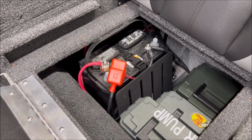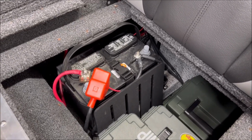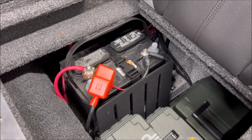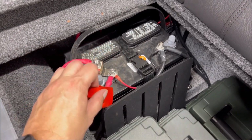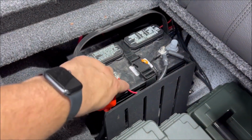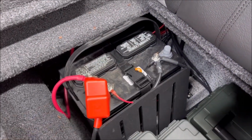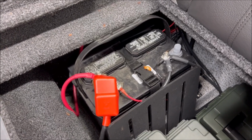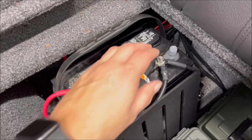As we're talking about electronics, we're going to talk about batteries. Now your boat, if you have one like this, you have at least one, and you may have as many as five, and they may be different types of batteries. But to start, we're going to check our connections. Of course, if you've got a bad connection, you might know it already because stuff's going to stop working. But things feel good. Nothing there to worry about. Now, this is really kind of an inexpensive flooded lead-acid battery. This is what the dealer put in here when I bought the boat.